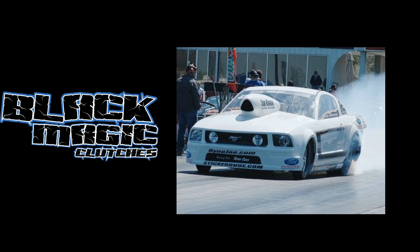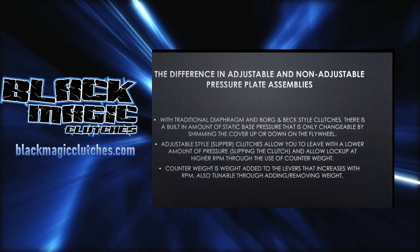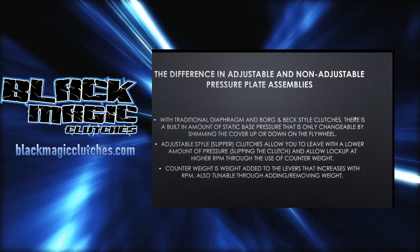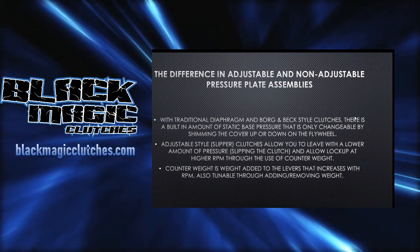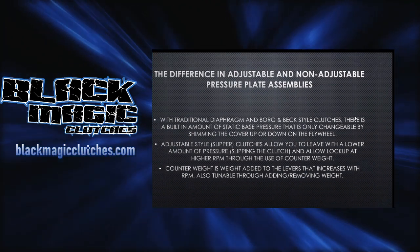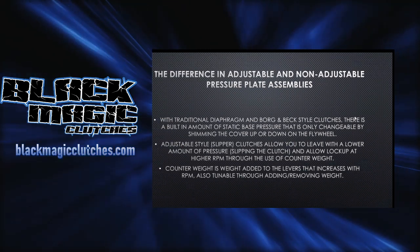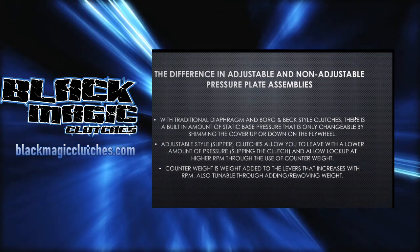Understanding applied clutch pressure is going to be relative to, like I said, friction coefficient. To understand this concept, understand that the more friction coefficient you have, the less applied pressure you need. It works in opposite, obviously. To start off, with the traditional diaphragm or Borg-and-Beck clutch, there's a built-in amount of static pressure. You can shim that pressure plate up, you can shim it down, you can add base pressure.